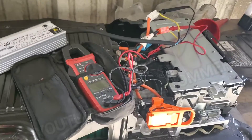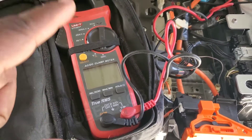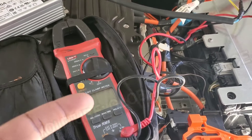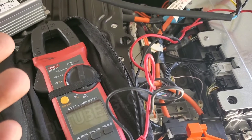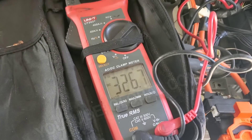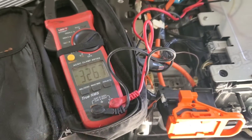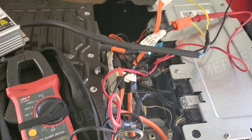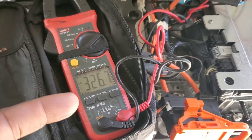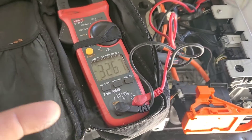It's now the next morning. This has been on overnight — I left it from 7 PM to about 10 AM, with the amperage very low. We're now up to 326 volts charged on the battery. That's quite a jump from 177 volts disconnected last night — the car was reporting 167 volts when connected. Now we have 326 volts, guys.